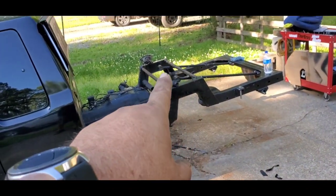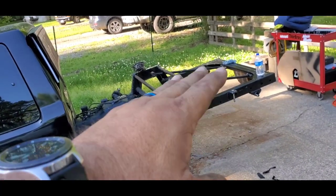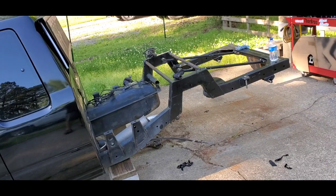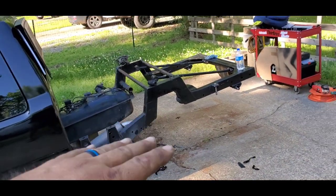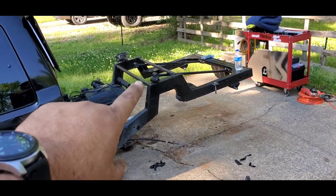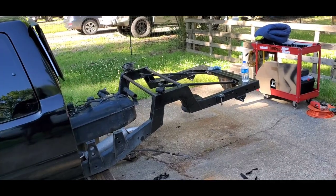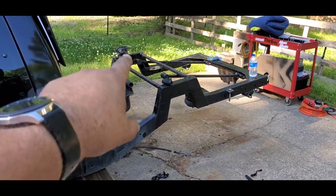Then you've got a proportioning valve on a Toyota truck that helps to level that out if you have a load, because it's going to ride differently with a heavy load on it, which with a bag truck is almost not possible, because you're adjusting the level of the suspension anyway. So that's why on this particular truck, I'm going to delete the proportioning valve and not put it on there, because I don't want it. You guys can argue with me, but it's going to get taken off.